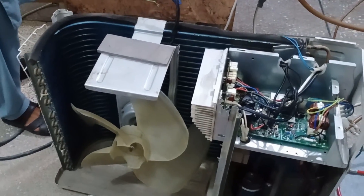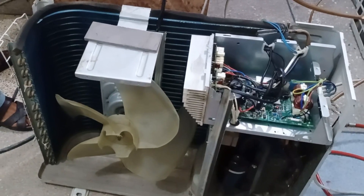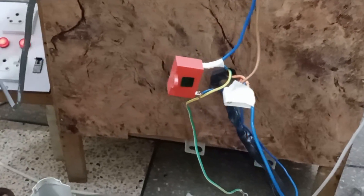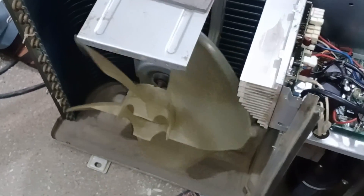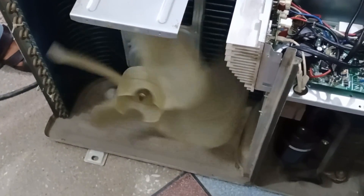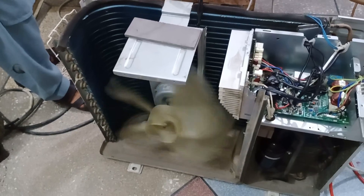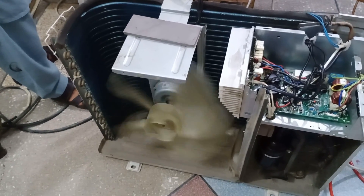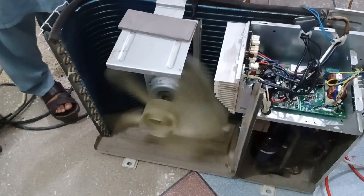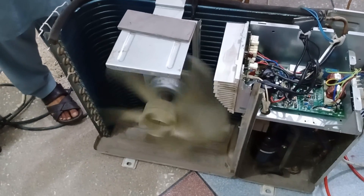Finally, I will check the fan motor of this unit by passing electricity directly through it. I made all the wiring connections at high speed and put the plug in the electric socket. It started to work, but the initial torque needed to start the fan was quite weak. The fan started to speed up, and then suddenly it slowed down. It is now confirmed that the problem is in the fan motor of this unit — I will have to replace this fan motor and the unit will start working fine.